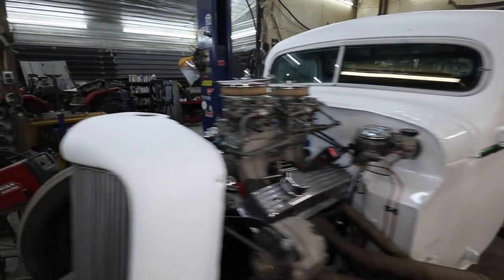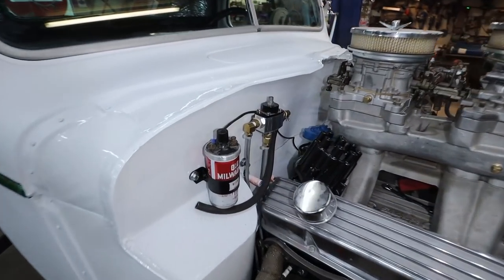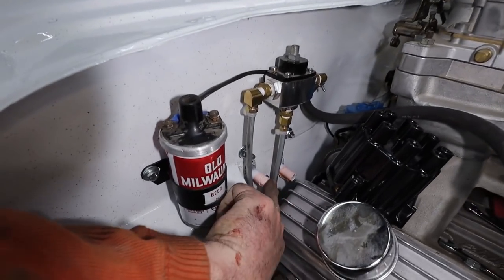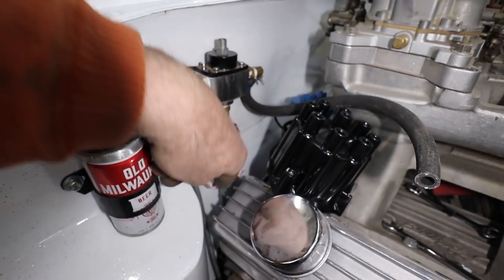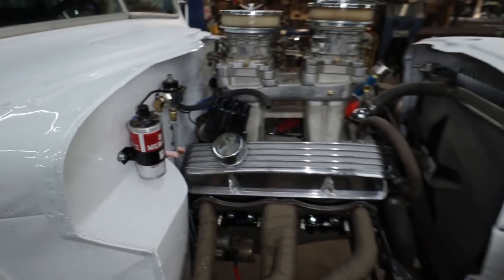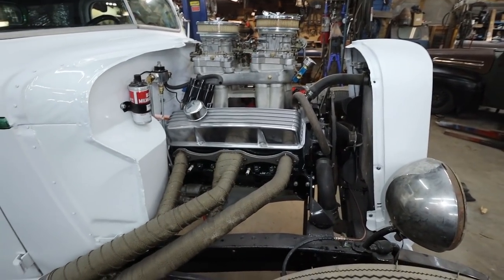And then I have my fittings in my Merc. So for my heater lines, I'll have to pull the heater motor out, but I've got some stuff so I can do these as like a 90 or a 45, so I can get them over the valve cover and run the heater hoses properly. And then we can plumb and fill this thing with some antifreeze.